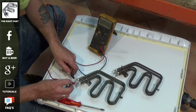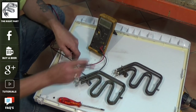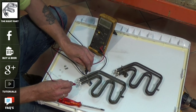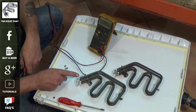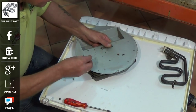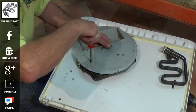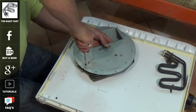With the new element, doing a continuity test you can see it's good. When I set the meter to ohms, you can see that the new element has no reading going to earth or to ground. I'm showing you this to illustrate the differences between the old and the new. To do a proper reading you will need an insulation tester or megger. Insert the new element and replace the three screws that hold it in place.